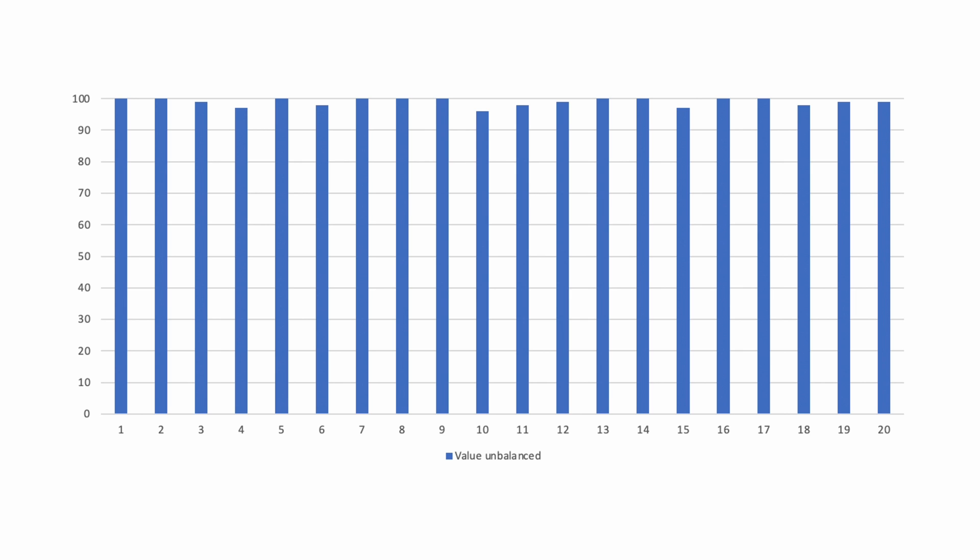This is where your battery is saying okay, I'm actually full, but I still have a little bit of room. So what needs to happen is that at the very top end the cells will actually be balanced. You have to look at it as kind of communicating vessels — the same principle. One cell is going to be depleted a little bit to fill up the other one. In the end we end up with every battery at 99%, and then we can add that very last 1% that we need. That is what is actually happening with the battery pack balancing.